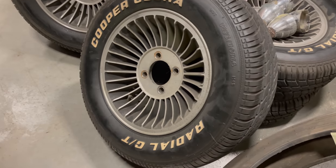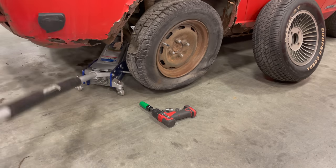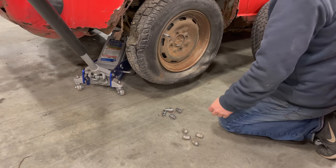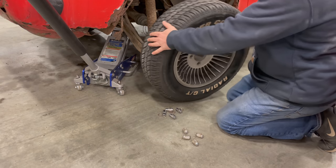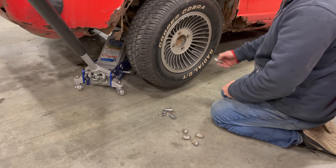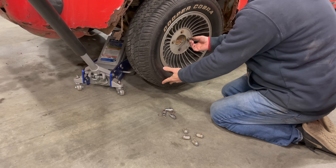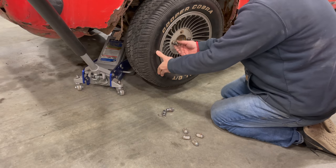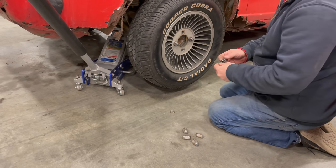I have a set of Western Turbines sitting around, so I'm just going to take one of these and put it on the car for now so it can be rolled around. These old wheels use the acorn style lug nuts, so I will need to change my lug nuts when I go to the turbine wheels. These are kind of a pain because you need to lift the wheel up to get it onto the surface since it doesn't ride on the lug nuts. I like to turn it straight up and down — sometimes the studs are long enough that you can get a couple lug nuts started and pull the wheel up onto them. Now they'll all be centered and I can get the lug nuts on easier.